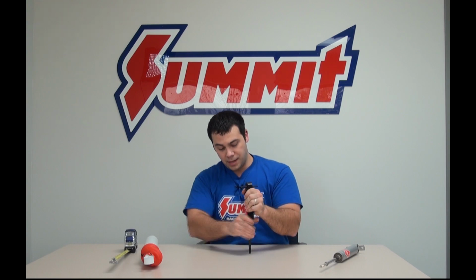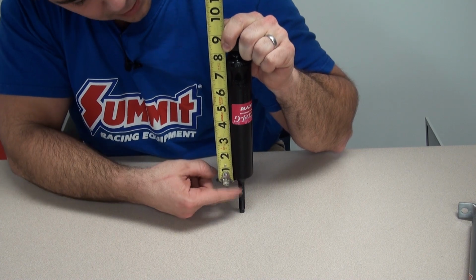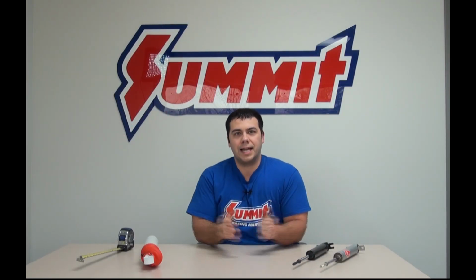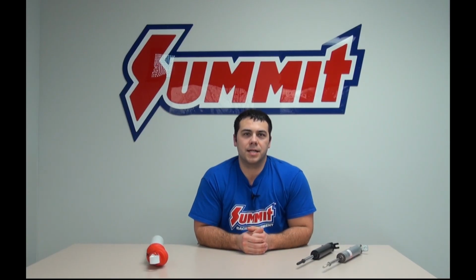The other measurement that you're going to have to take, and you might need a friend for this one, is the compressed length. And so this shock is 9.5 inches compressed. So with that information, 13.5 inches and 9.5 inches, I can take that to summitracing.com and find the right shocks for my vehicle.